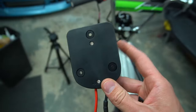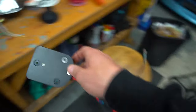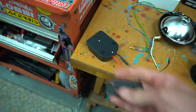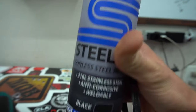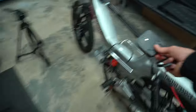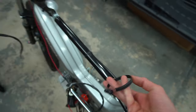For the Makita battery holder, I have it facing this way so the wires run clean underneath. It has a three-hole mount — the way I did it on the F12 was easy because I just screwed it into the inside of the seat well, but the pook has nowhere to mount it. So I came up with a little metal piece, drilled two holes for bolts through a small slit I made. I painted this piece with Steel-It — it's like $40 a can but it has stainless steel in the paint and makes metal look powder-coated. A hose clamp I also painted with Steel-It will wrap around the frame and hold everything.